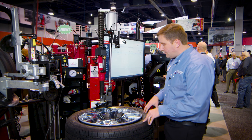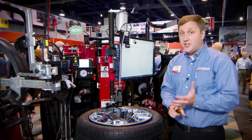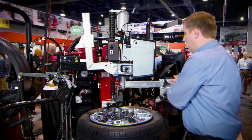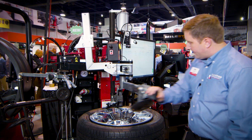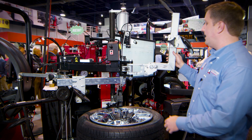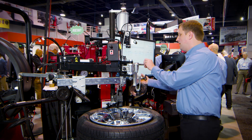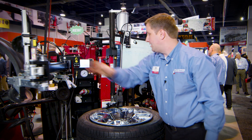What also makes this machine unique is the fact that we've put on the full BPS on this, so for really tough tires — ag tires, implement tires, low profile and run-flat tires — I have two discs here. A rotating disc with a cam action that actually relieves bead stress as it travels around automatically, and a fixed disc I can bring down that locks in place to really keep that over-under condition across the back of that mount head on those tough tires.